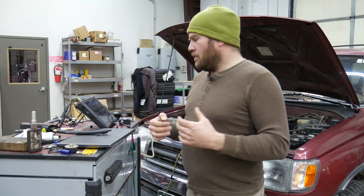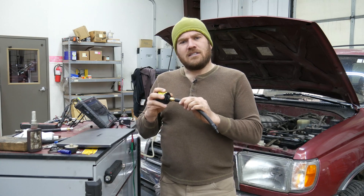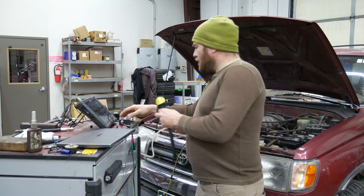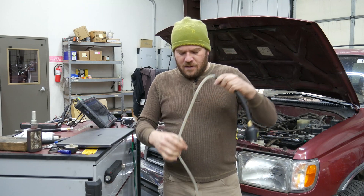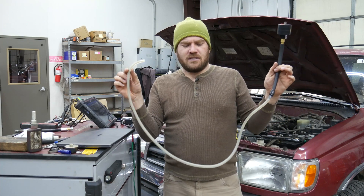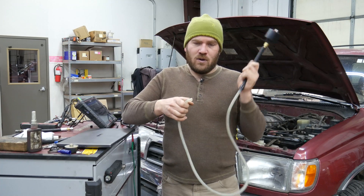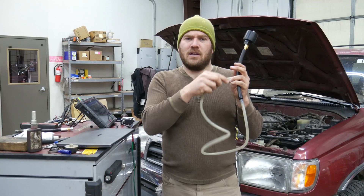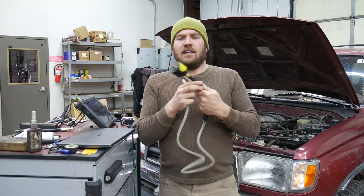So what we're going to want to do is hook up — if we're looking at our pulse sensor, these aren't meant to have liquids put inside of them. We have to watch that we're not getting coolant inside of the sensor because it's going to affect our readings and it could damage the sensor. I like using this clear hose — this is off my snap-on vacuum gauge. It gives me kind of a buffer. If I see coolant going into this hose, then I can shut the vehicle off real quick, or I can unhook the pressure transducer — actually what I normally do is unhook the hose from the radiator, because any pressure built up will expel that coolant back out of the hose. So it's something you want to watch out for. Don't get junk into your sensor.